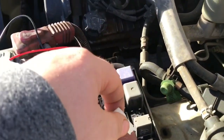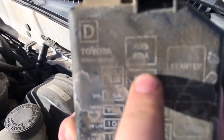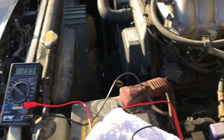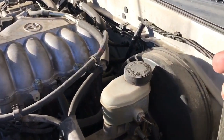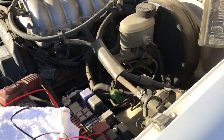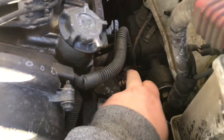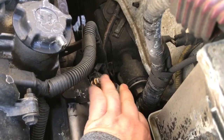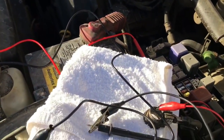Another big indicator is the alternator - it still works but it's a common culprit for parasitic draw, pulling three to four amps. To check it, go directly to the alternator, pull the main power wire and the back plug off. If the draw drops after disconnecting it, your alternator is going bad - likely related to a diode failure.